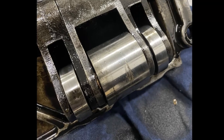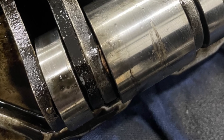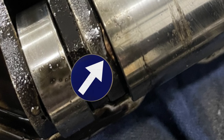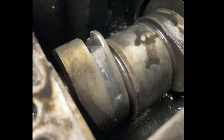This week's Destruction of the Week comes from Dominic. He had a C12 that had a miss on number four cylinder, and he found this — there's actually the brass bushing for the roller there; the injector roller had pushed out. What's weird is the one we're looking at is actually number six. Number four was the one missing, but number six looked way worse than number four, yet number six was running fine. Number four was the one missing and that one didn't even look that bad. Thanks for sending the picture.